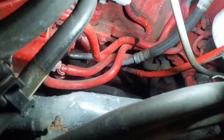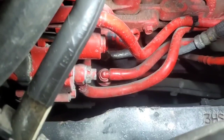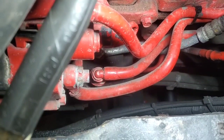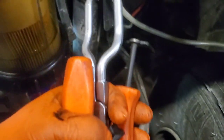Now that that line's all hooked up, we're going to go ahead and hook this line up. We've got to hook it up to the left side of the pump — that red connector right down there. To pull that off, you're going to see there's two clips on the other side — not really clips but tangs that you push in. There are a couple different tools we could use for that, depending on how easy the access is. Got this style that's 90-degree, this style that's straight, or these pliers here.